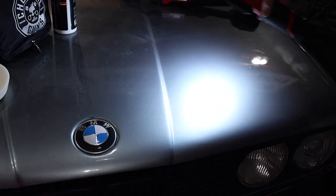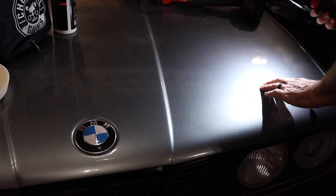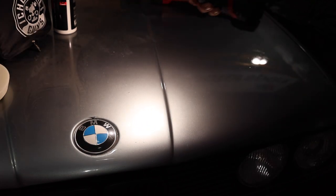Here's where that light comes into play one more time — we can really inspect the paint. I see some heavier scratches here, but the optical clarity is so much better. It's really hard to pick up on camera but you can see from there to there — the reflection goes from junk to way crisper. With my actual eye looking at that bright spot, it cleans up really well. You can inspect your paint very well with this thing — it's really awesome.